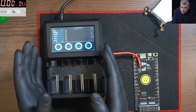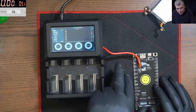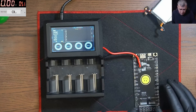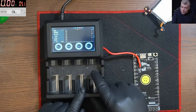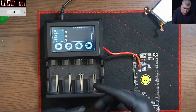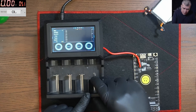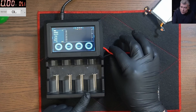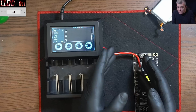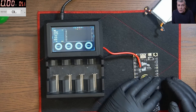So what we have here is that kind of device testing normal batteries, and I took two wires from here. This is not a stable connection. First I soldered the wires from here, but it's not a proper connection. So I soldered the wires straight on the board — flat wires — so we can keep the internal resistance low. And this is an activation board.